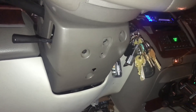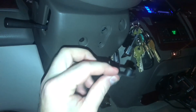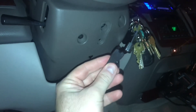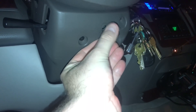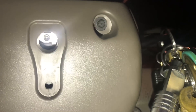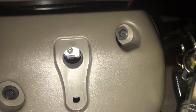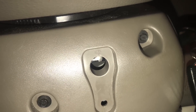On the bottom of your steering column, you're going to see this little rubber plug. I pulled the whole thing out, but basically you just want to pry it open. In this large hole here, there is a bypass — a little bypass button for the parking lock. I'll show you exactly what you need to do to fix this, or at least to get it started so you can go get the car serviced.